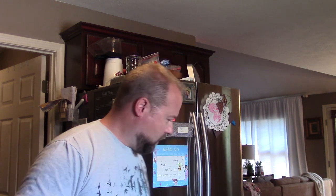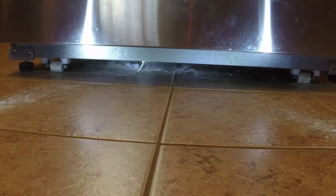It's one of my favorite tools. I've got my GoPro on the ground right now looking at underneath the refrigerator. There's not a lot you can see from the front. This is a Samsung French door refrigerator with a chest pull-out freezer — very popular models these days. In this one there's no toe kick in the front, it's just wide open. A lot of older standard refrigerators with the freezer on top have a plastic grate in the toe kick area — you just grab either side and pop it right off. It just snaps off with two spring clips.